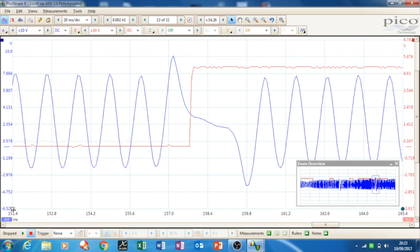There is a noise, there's a rattling noise coming off the car, and I cleared the code, and as soon as you took it a wee run again, that code came right back. So I think there may be enough evidence to call a timing chain, but I'll let you know. Cheers.